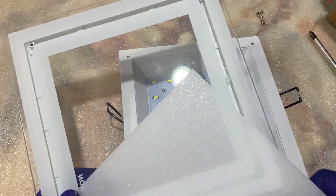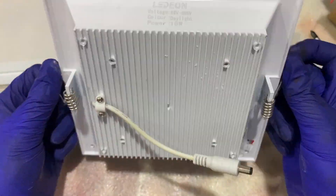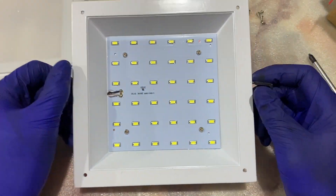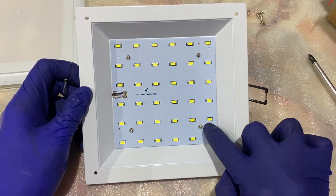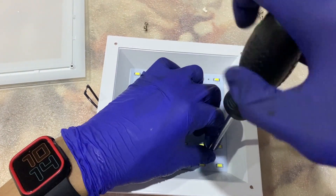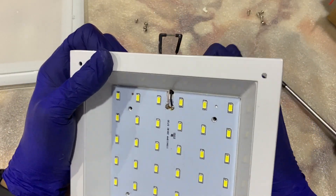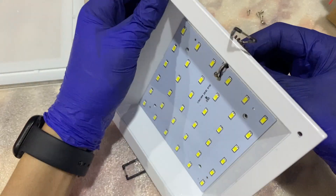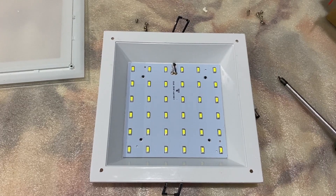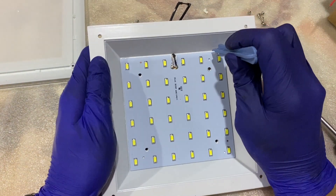Then there's the diffuser, the glass, and also the mounting bracket — three items to set aside carefully; it's quite fragile material. Moving on to the LED panel, I was going to remove the wire mounting to push it out but found that was impossible. So I removed the four mounting screws using a Phillips screwdriver. I tested this LED panel and found there was a disconnection in the wiring circuit. Since I'm not going to repair it, I used a plastic pry tool to pry it open.